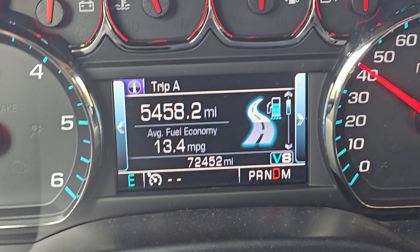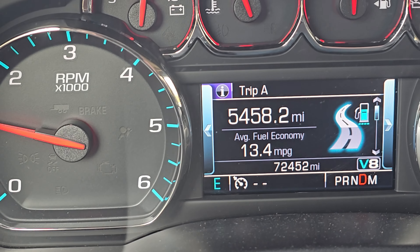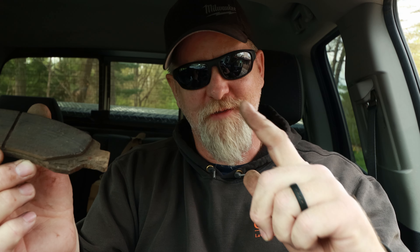I would like to think it was my skill, my driving skills, but a 2016 Chevy Silverado with 73,000 miles on one set of brakes — that's pretty good. I can't take all the credit. I believe it's the Chevy Silverado's tow-haul mode. When you engage it and tap the brakes, it'll actually downshift through the gears and slow you down, and then I would apply some brakes.